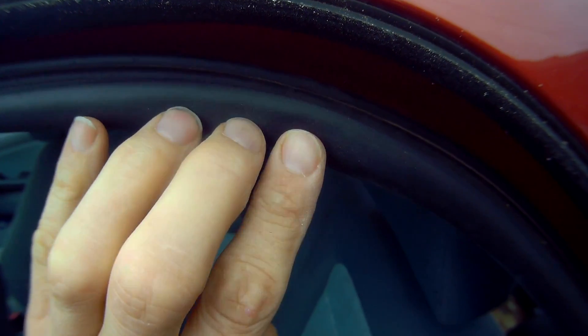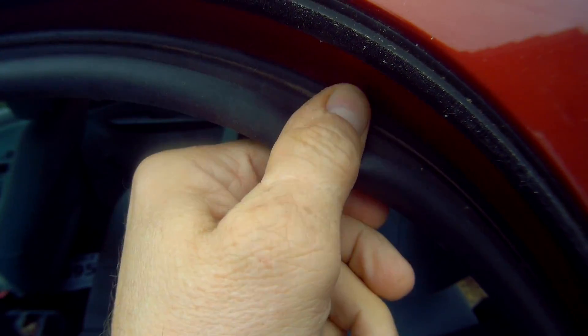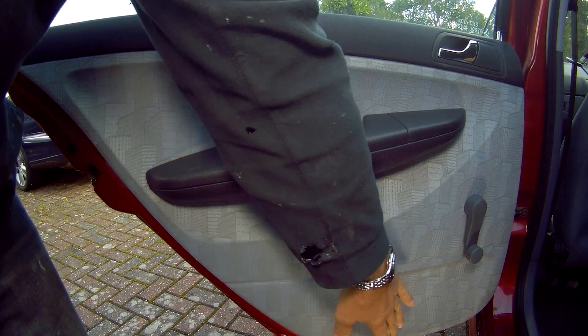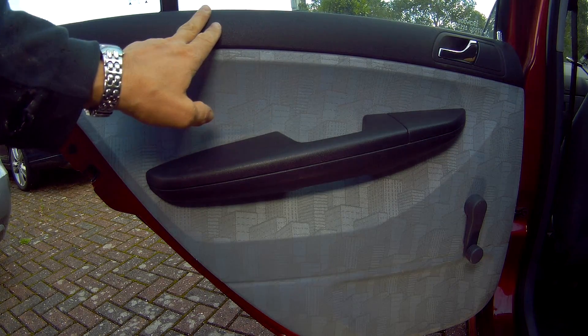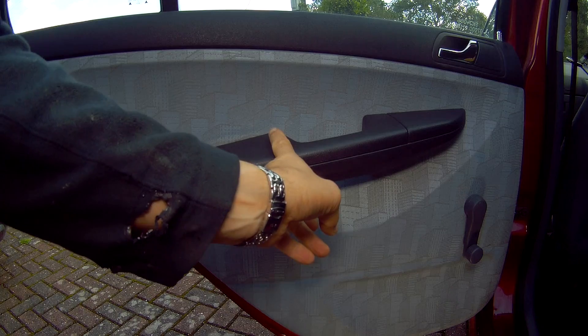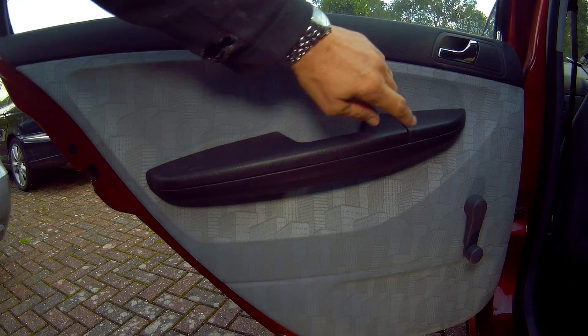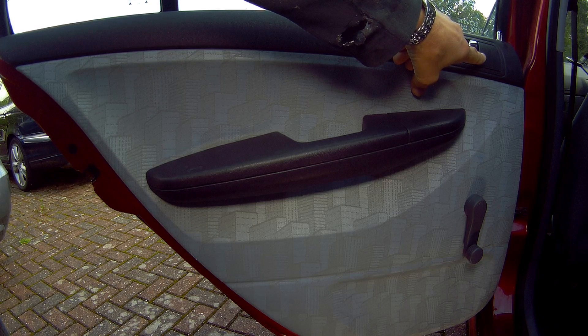When you're happy with the door seal working okay, we can turn our attention to releasing the door panel at the bottom. These panels are held in place by a number of plastic push clips around the perimeter, as well as being hooked on the top of the door by a running lip on the panel. It's also secured in the centre by two large Phillips screw bolts hidden inside the handle, and there's a further top screw hidden behind the opening handle, just behind the speaker grill.